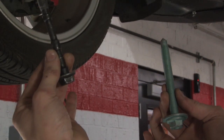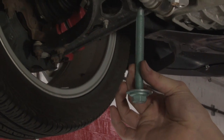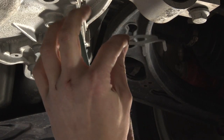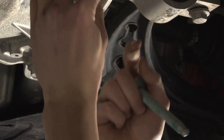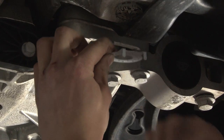This is the bolt I just picked out of the subframe. This is the bolt I will be installing from the kit. When installing these, you need to have this between the frame and the subframe, with the fangs facing towards the back of the car and down towards the ground.